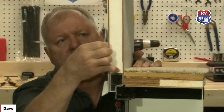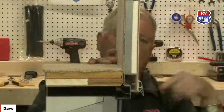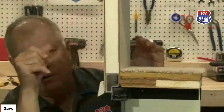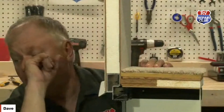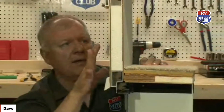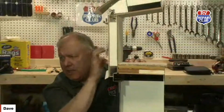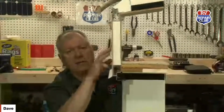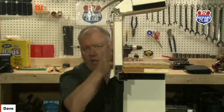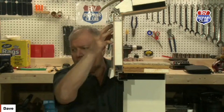Then another Luan paneling, and inside that you would have some framework like this around the perimeter, maybe a couple in. There's no uniformity in what framework they have in these units, especially in '94. You might even have wood, what they call stick and tin, and then Luan, and then an outside fiberglass. I think your Travelmaster probably has the Mesa sidewall, it's called. It's ribbed instead of flush, and it comes in about 18-inch seams, so you have those up there.